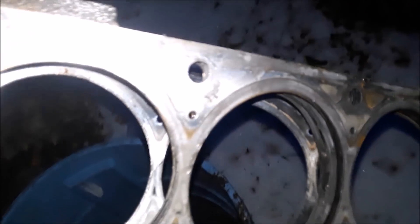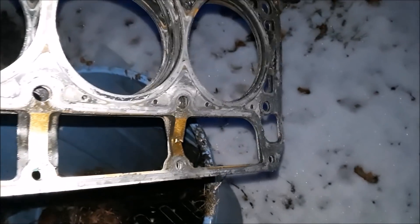Maybe I'll have the block hot tanked. I called the local machine shop that's good with doing hot rod stuff and they're at about a hundred bucks a piece for the heads to hot tank them and pressure check them and check them for squareness. I really have no doubt that the deck surface is fine — there's no reason, I mean the head gaskets on this thing look like they're brand new. These head gaskets — they're all messed up now, but there's not even any varnish or dirt or oil or nothing. The head bolts come out looking brand new.